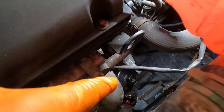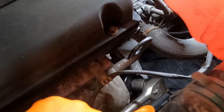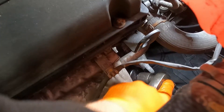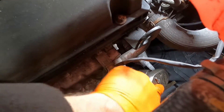If you've got a torque wrench, this is only 25Nm. You actually can't really tighten it any more than it will go. Just remember that it's plastic, so don't be too rough with it. You'll know if it doesn't seal, because when you put oil in and fire up the engine it'll leak very quickly.